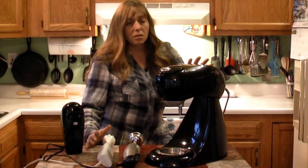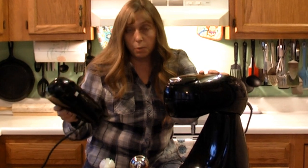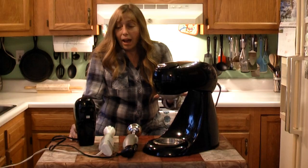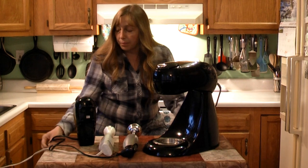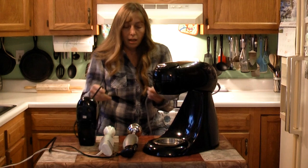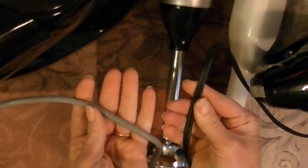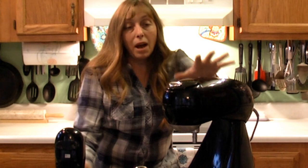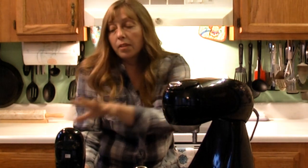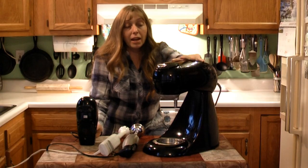A lot of things affect duty cycle. This mixer sells for two to three hundred dollars; this one was about 15 dollars, a Christmas special at Walmart. Amperage-wise these two mixers claim the same motor, but clearly they don't. One thing they do to save money: if you look here, you can see the wire size. The wire in the expensive mixer is much bigger than the wire in the cheaper mixer. Bigger wire can handle more heat. The wires in the motor of this mixer are much bigger, and the gears are better lubricated and smoother.